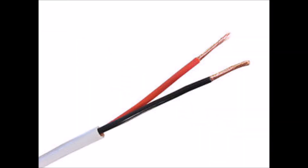You can use most any type of cable as long as it's stranded and is as big a gauge as you can afford or that will physically connect into what you're connecting to. You want to look for oxygen free copper and stay away from copper clad aluminum. And for easy identification, you want red and black wire so you'll know which one's positive and which one's negative.